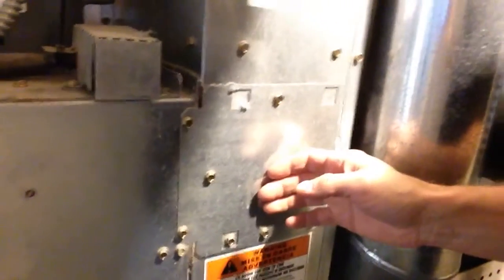So what we're gonna do is pull this cover off here. That'll let us take a look in and see if there's something on the fan itself. A lot of times you get that it's a dryer sheet stuck in the fan, which throws it out of balance. So pull that off and take a look and see what we got in there.